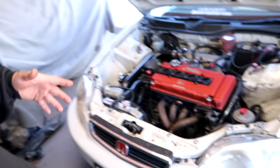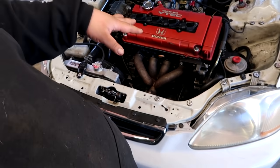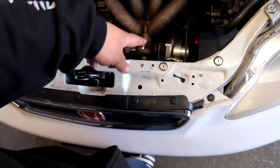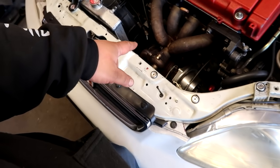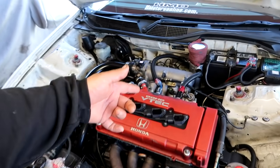So the motor in my cousin's car right here is a junkyard LS block, stock pistons, stock rods, and it's got a stock Type R head on it. We got the Nomis Industry coil pack system, an eBay GTX3582R, a Love Fab mini ram manifold, 3-inch downpipe, eBay intercooler system, 1000cc Precision injectors. And this car on 14.5 pounds made 361 wheel horsepower.